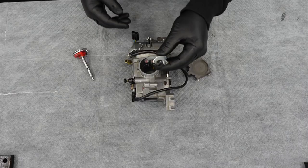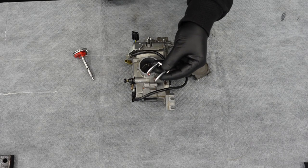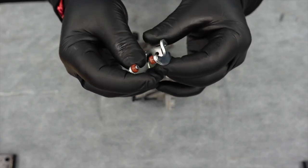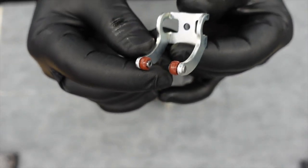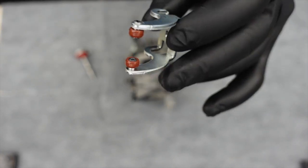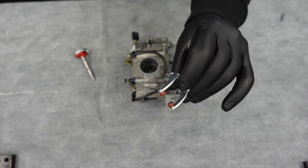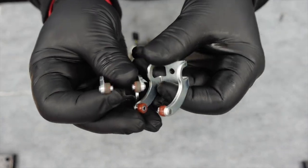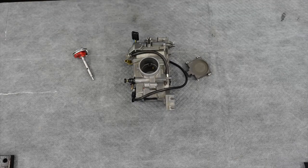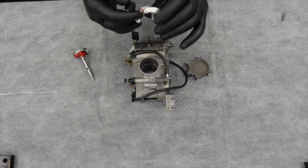Since we can't put this in right now, we're going to wait for the new part — and just like that, we've got our new part. You can definitely tell those rollers are kind of that harder plastic — much, much smoother. So if you really want just that buttery throttle slide, I'd probably recommend replacing this guy. It only ended up being $16 to $20 for this piece. If you look at the two in comparison, the old wheel is a little bit rough. I don't think it affected the throttle slide much, but if you want the best, most buttery throttle, go with the new one.